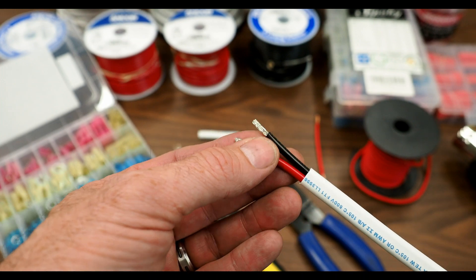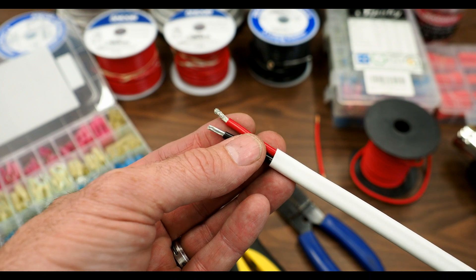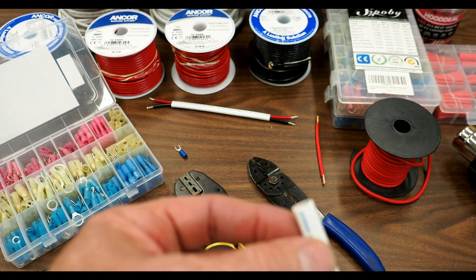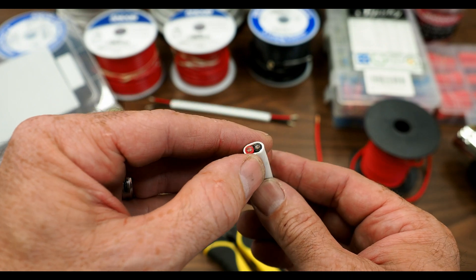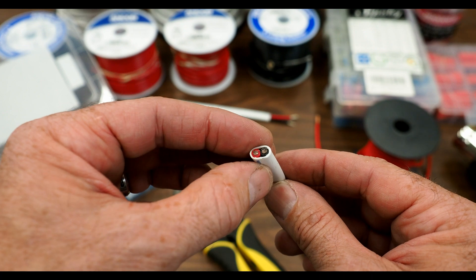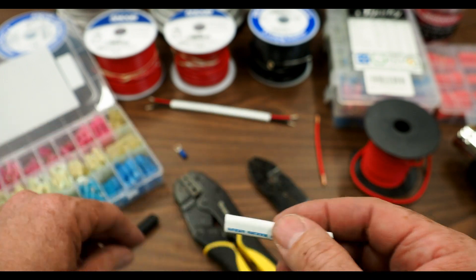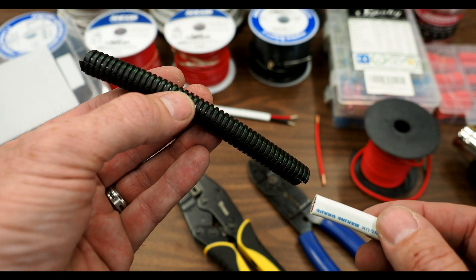This application works a lot better for marine environments, or underneath the car in the engine bay. I use it throughout all my builds, both internal and external. The wire we're also looking at here is a duplex wire. You can order this wire in many different types — this duplex wire basically has two wires, a positive and negative, individually insulated, and then those wires are wrapped in an oval insulation jacket on top of that. This extra jacket makes it more abrasion resistant and also gives it another layer of water and moisture protection. This is what I run through the walls in my Sprinter build. I use duplex wire extensively, and then I'll take a piece of plastic loom and put it over the duplex wire as an extra layer of abrasion protection, and snap ties to anchor the wire into place.